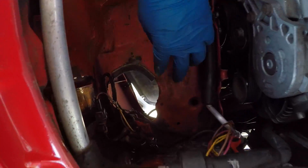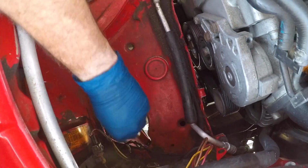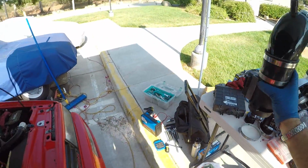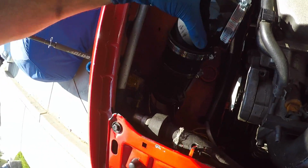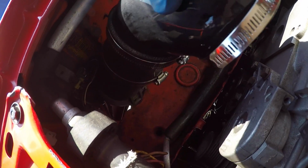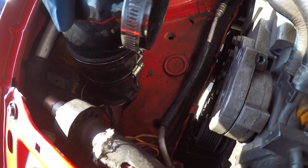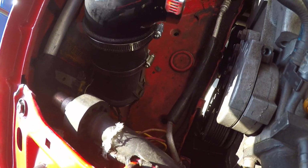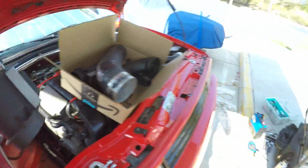And that opens up this hole down here for us to put the air filter and mass airflow sensor through. Here's the intake boot for the supercharger, it will sit kind of down like this. And there will be more piping that goes down deeper. So the mass airflow sensor will actually be underneath through that hole. And yeah, that's how that works.